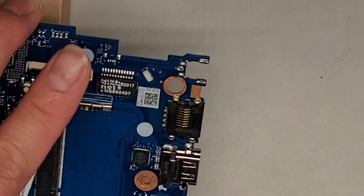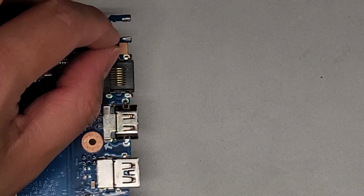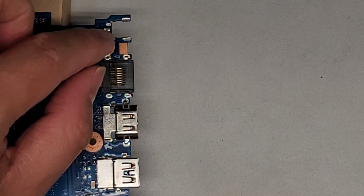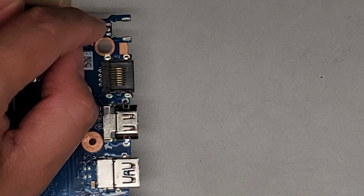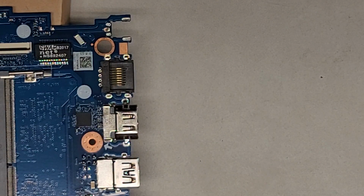Usually what I like to do is use a solder sucker pump. I'll add a tiny bit more solder here so it's not completely sucked into the hole, and it also reduces the melting point of what's left in there. Then I'll use the solder sucker while it's hot to pull that out, and you'll get to see that. So let me go get those tools and I'll be back.